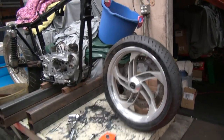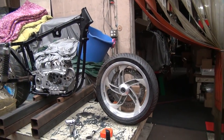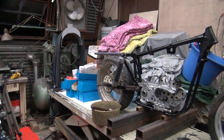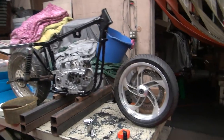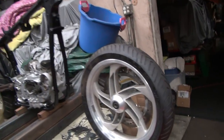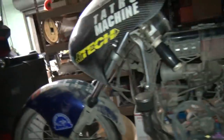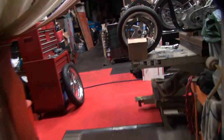So I'm thinking a little sport bike front tire. We'll make a spoke version though, because we like spokes. And we can run the 18 like that in the back. That'll give him a good handling bike. The rake and trail should be decent because it's going to get the rake down to where it'd be decent. Let's see what the rake would be on that thing. It'd be a lot less than my bike at 40. See, I run 40 on my bike, but I like going forward.